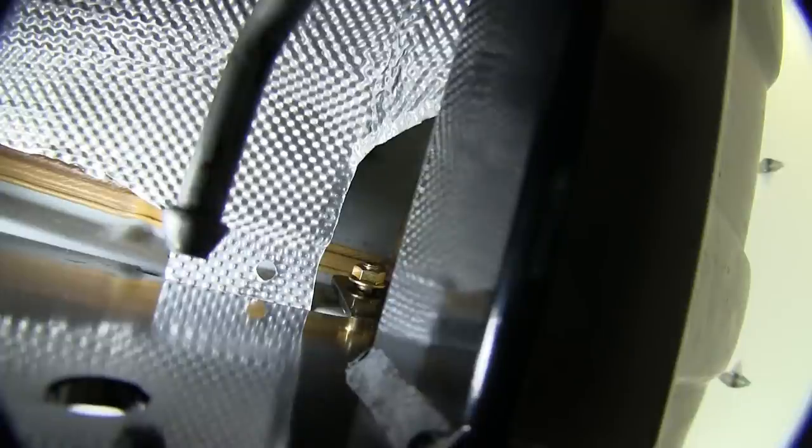When unthreading the fish wire on these two locations, be very careful that the carriage bolt does not fall back into the vehicle's frame. These two mounting locations can be done, but it does take a little bit of patience — you will need to work a little slower here to make sure that you don't push the carriage bolt back into the frame. Once you have the carriage bolt and spacer block pulled into place, go ahead and put the hex flange nut on for each side.